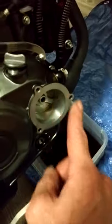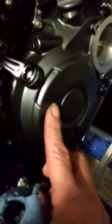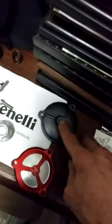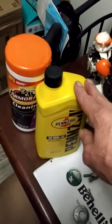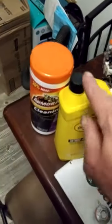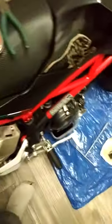All these right here — if you ever work on all that, same thing with these: don't tighten any of these down very much. This is just cheap, thin aluminum casing — it'll crack in a heartbeat. That's about a quart — a little over a quart of oil you want to replace. When you put everything back together in reverse, about a quart of oil, 10W-40, a little bit more than one quart, and that should do it.